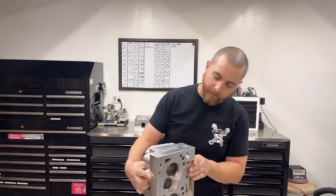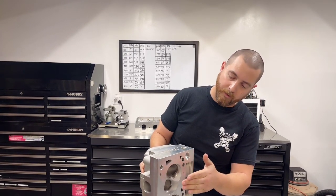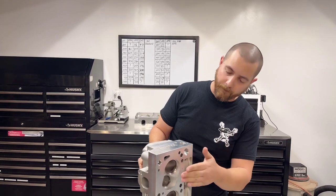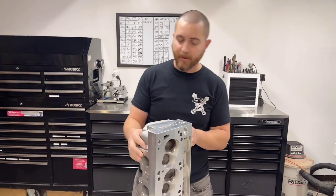The reason for that is, as the valve opens, it actually moves towards the center of the cylinder — basically away from the cylinder wall and away from the chamber — and that really does help with improving the flow numbers. That's just the reality of the canted-valve design.